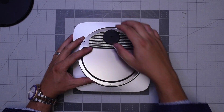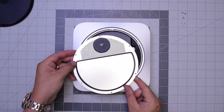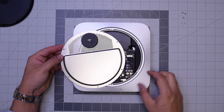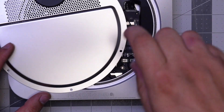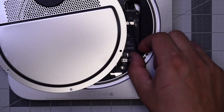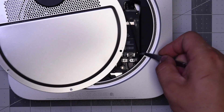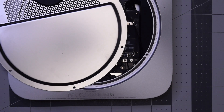With those six removed, go ahead and start pulling up on the Wi-Fi antenna. Be careful — it's still attached to the Wi-Fi and Bluetooth card. Right here, go ahead with the T6 screwdriver, remove that screw, and then you can gently with tweezers go ahead and pop out the antenna and disconnect it. Now we can move this out of the way.